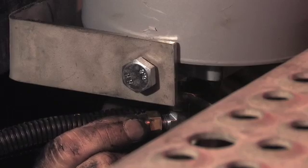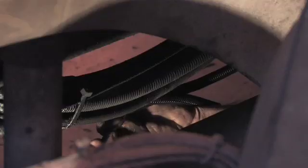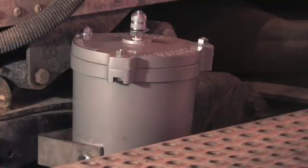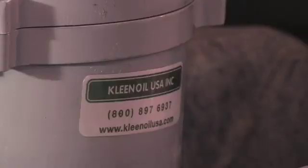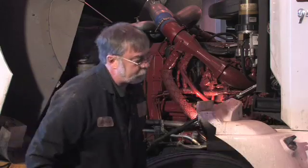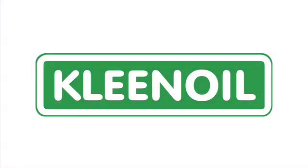Make sure that all connections are tight. Secure both hoses beneath the truck with zip ties — use as many as needed. Apply the 800-number sticker to the bowl. Start the engine and let it idle for several minutes, checking all connections for any leaks. After a few minutes, place your hand on the filter bowl to check that it feels warm, indicating oil is flowing.